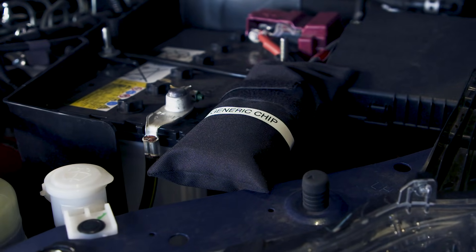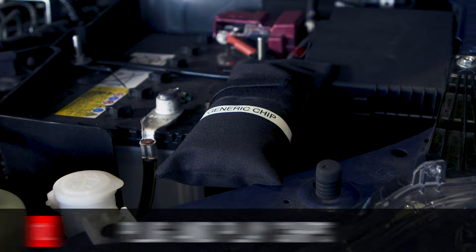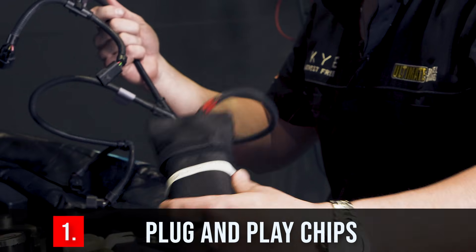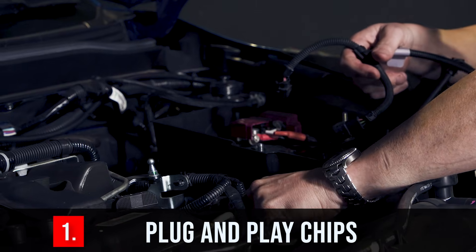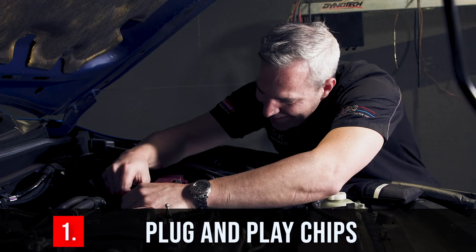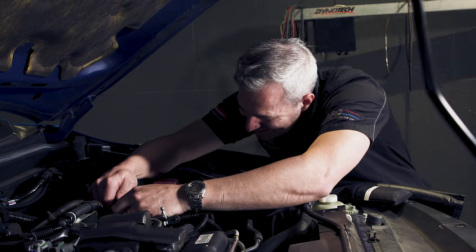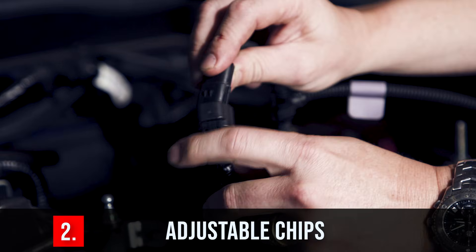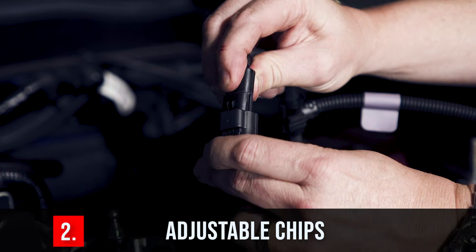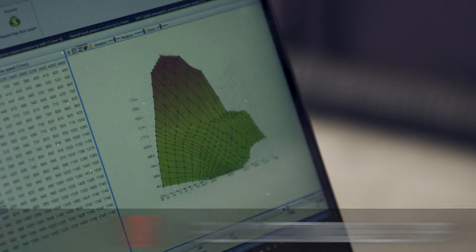There are two common ways of getting more power from your diesel. The first is a diesel chip. Many chips are simply plug and play — someone has put a general program in them without custom tuning it to suit your unique engine. You put them in and can't adjust them. Some only increase fuel pressure, some have very basic adjustability with only four or five preset settings altering fuel and boost pressure only, and some are very tunable.